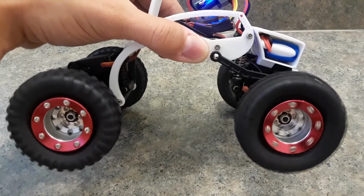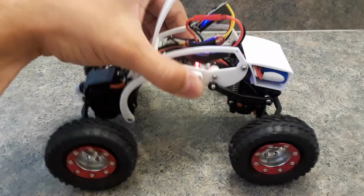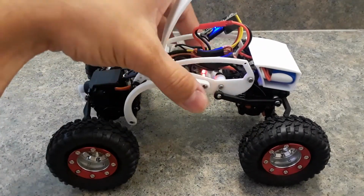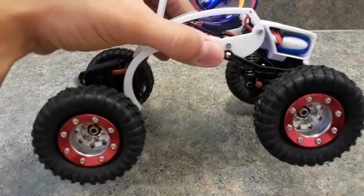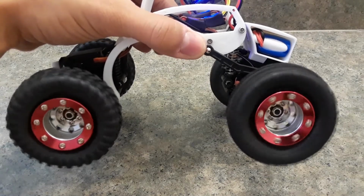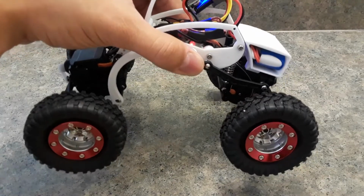A lot of guys do that with a 1/10 scale. What they do is they put a bigger pinion in the front if they have the motor on axle designs like the XR10. They'll make it go faster in front than in the back. So that's what you're getting with this. It's pretty simple because all you got to do is just use a faster motor up in front. So that's that. And then we go back to...